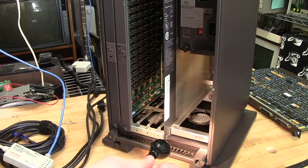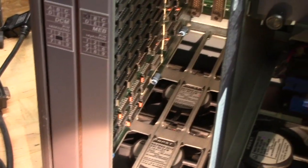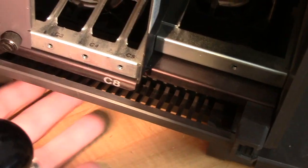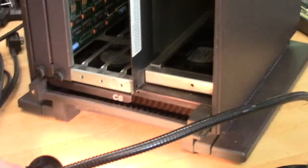You can also now see the three cooling fans that are in the bottom of the system. Those blow upward past the hard drive to cool the hard drive and the power supply. There are also two fans on the side where all of the circuit boards are. This is all just a common plenum underneath — air gets drawn in through vents on the back and also through vents on the side. The fans themselves are mounted in a removable tray, customer module 8.